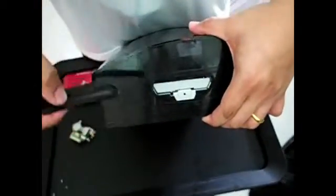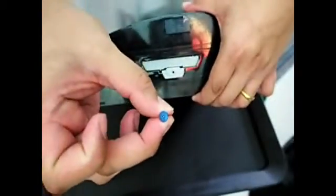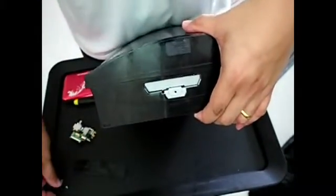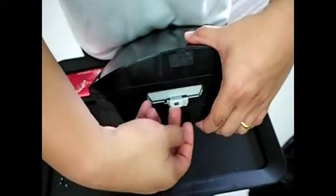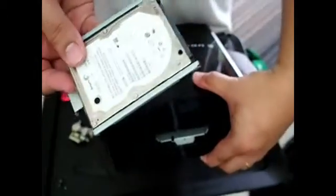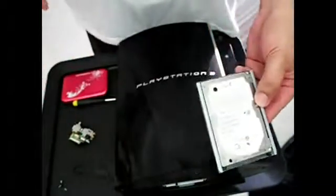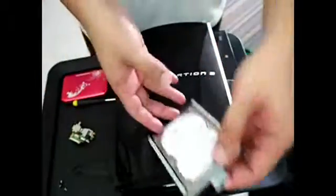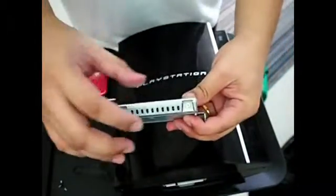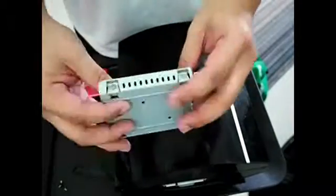There you go. This area here is called the hard drive bay, the hard drive port. I already unscrewed it. You will normally see a blue screw over here holding it. For the sake of convenience of this video, I already unscrewed it ahead of time. All you have to do is, when you've flipped it out, gently pull the flap out and slide it out gently. Ladies and gentlemen, this is the hard drive — the heart of the entire PlayStation 3, where you store all your saved games and digital copies. Once you slide it out from the bay, you can see there are screws on the side.